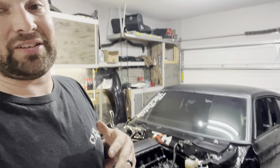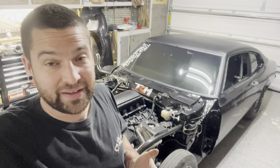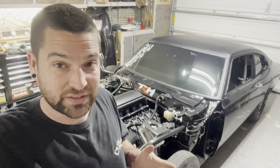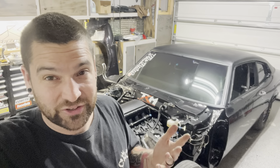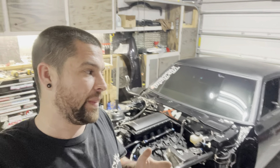We cannot do the alignment and the scaling on the car. We need to scale the front of the car in order to get a very precise measurement. Uncle Mike wants to make this thing on kill — he wants this thing as soon as it comes out the box to basically be ready to roll. He said he needs very precise measurements on the weight on the front. So this car needs to be completely race ready — fenders, hood, whole nine yards on the scale. If we don't have the turbo on there, that's a lot of weight. We want this one precise, so we're going to have to wait until we get the turbo back. Still missing a couple of pieces — one item maybe for the front end for the bump steer, and we just got to finalize all the geometry.